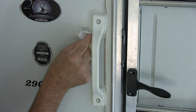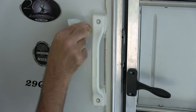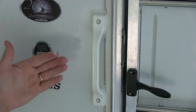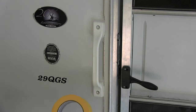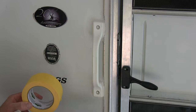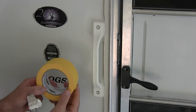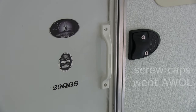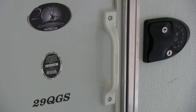Some of that Goo Gone is helping. I think you just go real light with the caulk and then add a thin bead on the outside. But when I look at these, they're like caked with this caulking. If I had to do this all over again, next time I do something on the exterior of the RV, I'd dry fit it first, put tape around it, leave a small gap for the caulk — that way I won't have all the mess. I'll also have some mineral spirits handy. The cure time on this is about a week, and it's already starting to harden up so the handle doesn't move as much. After a week, I'm sure that handle is going to be on there spot on.